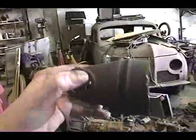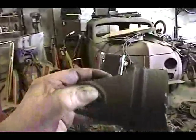Now, a long time ago, I put a V8 in a Vega, probably about an 81, and I didn't have the money to get a drive shaft cut. Back then, I didn't have a lathe either. So what I would do was just grind that weld. I'd take a couple of hours and grind that weld down, and then it would be nice and smooth where I could shove it back into the tube. Anyway, I'll show you how I do this here as I go.